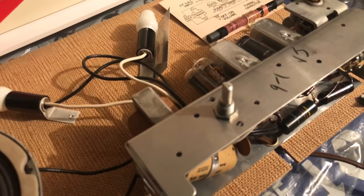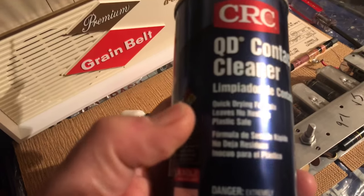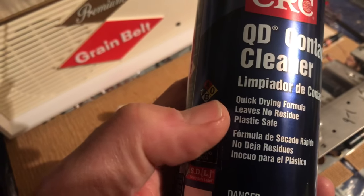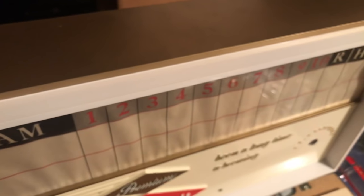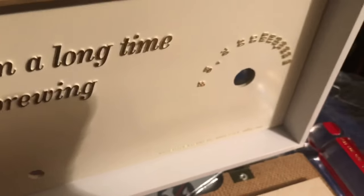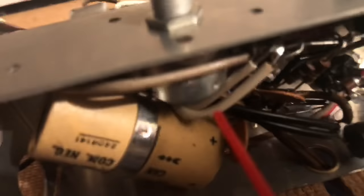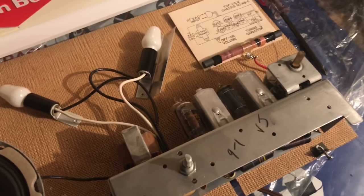What I found out: go to Home Depot and get yourself a can of contact cleaner. It doesn't have to be this brand, but the big thing is it has to be plastic safe — the case and the radio are made of plastic, and if you don't get plastic safe and you spray it, that's not good on a new old stock radio. We're going to spray it right in there where it goes down, and underneath there's a little hole in the side of the volume pot — we're going to spray a little bit in there too. The last radio I fired up, smoke actually came off the tubes — we'll see if we can replicate that magic.